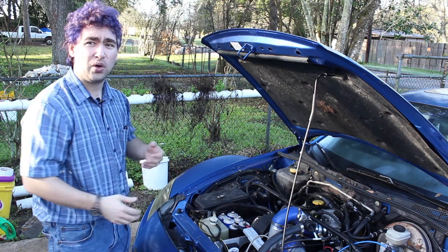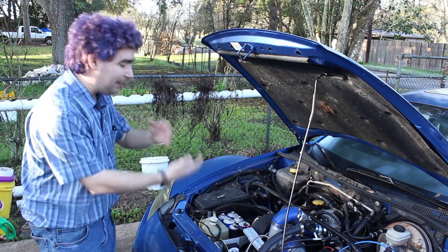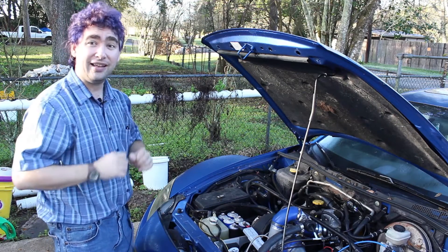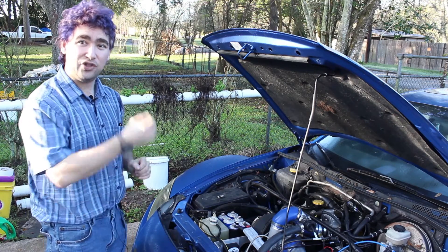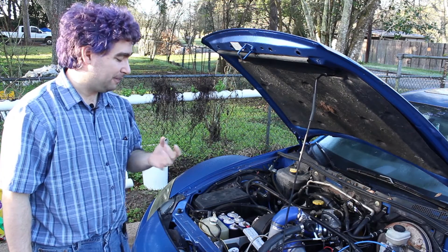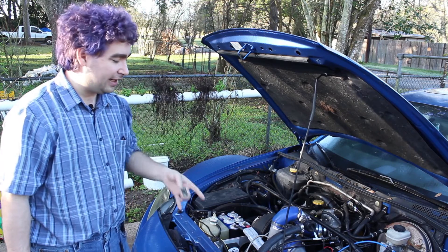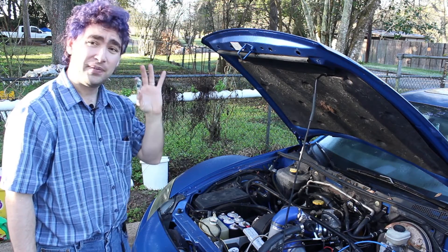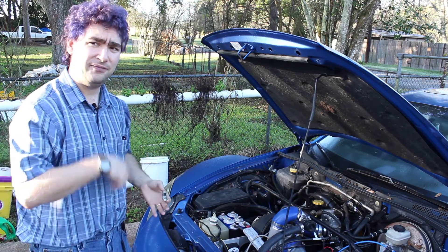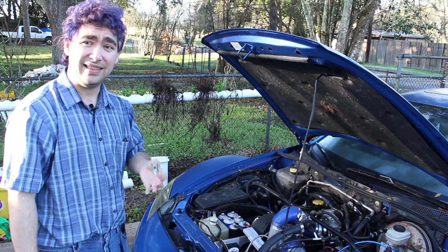Fast forward a week and a half. I have the new coils in hand. It's time to replace them — pull out the old coils, put in the new coils. Let's crank her up and see if she starts. But she still had the wrong chip. This chip in there was programmed to ignite each of the spark plugs once a second. It didn't follow the cranking pattern or timing or anything. Just once a second.